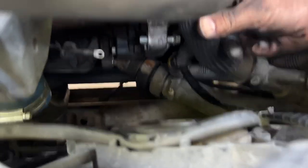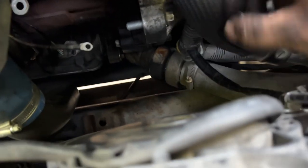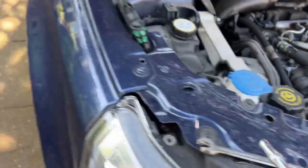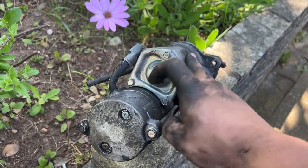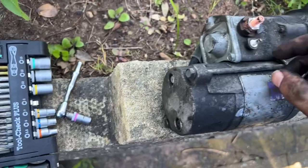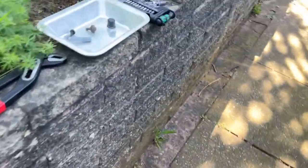The other bolt at the back is still sitting there, and there's another bolt there behind - you can't see great filming it. The bottom bolt actually just took access as much. So that's where I'm at now - I'm going to get onto the actual repair of the starter motor, which according to the instructions that come with the kit involves undoing three bolts to get into the solenoid, then swapping a few little bits over, putting it all back together, back in the car, and hopefully done.